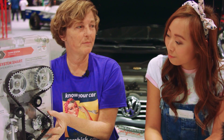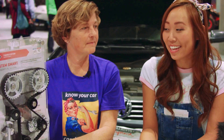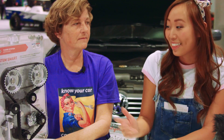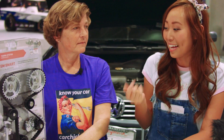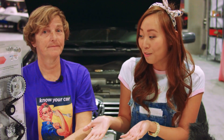There is also a gasket at the water pump — if you have a water pump underneath your timing belt, please change that too. Would you like to spend hundreds of dollars to go back in? This is a very valuable tip: when you go in to get your timing belt changed, ask them to check every component in there — all the seals and the water pump — because that could break weeks later and you'd find yourself back at the shop spending hundreds of dollars again. Also, ask for the old parts. Hold your mechanic accountable by having them show you the old parts they switched out.